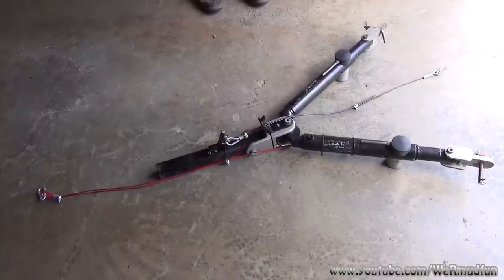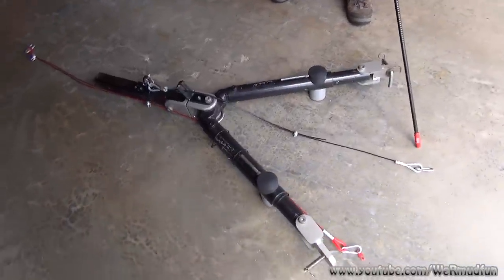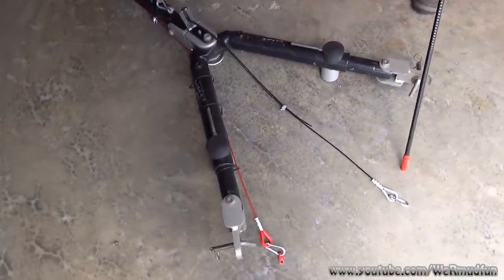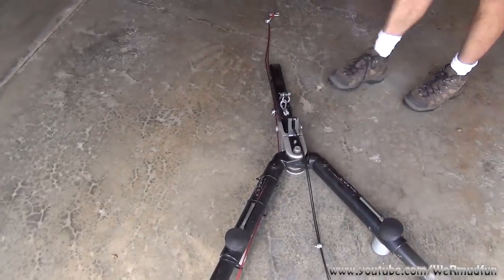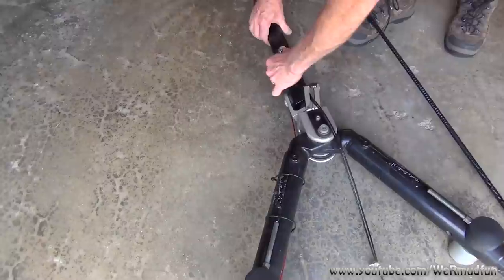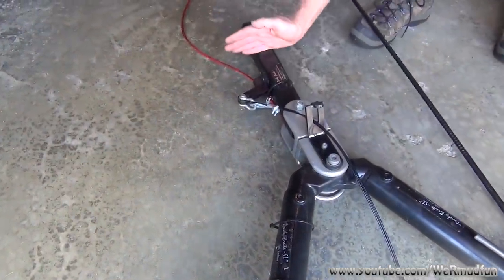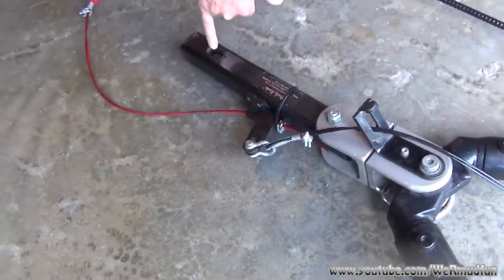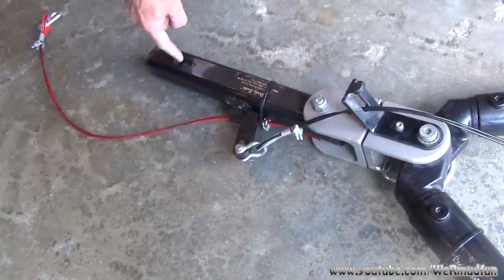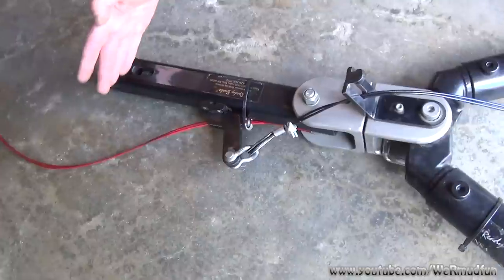The braking system itself for the Ready Brake — this cable here attaches to a cable that goes to the brake pedal. We showed in that video how that works. And then that comes up to this unit here. This is how the surge brake actually works. Let me turn it so it's a little clearer. Let's just say that right here is where you're connected to the RV. If you notice in here, it's oblonged out — as the pin goes through, it's going to allow a plunger on the inside to activate every time the brakes work.